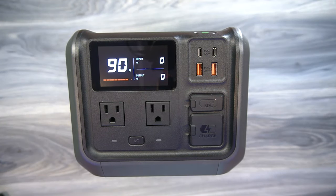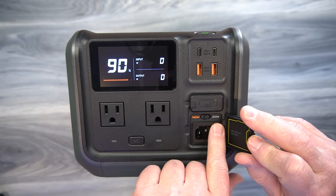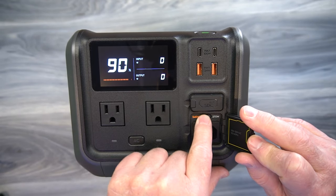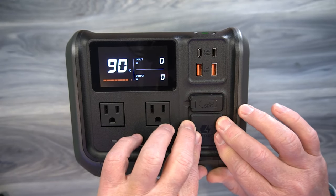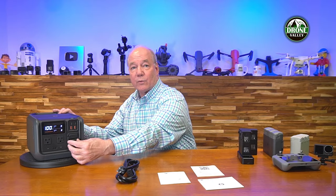When you open the door where you plug the cord in, you'll see a switch on top that says 270 watts or 540 watts. To fast charge, you'll have it in the 540-watt mode. You might wonder why you'd ever use the lower setting — well, if you're plugging it into a kitchen outlet, there's a good chance other things are on that circuit like a coffee maker or toaster oven. Putting it in fast charge mode might draw too much current and pop a breaker, so you can knock it down to 270 watts and it'll still charge quickly.